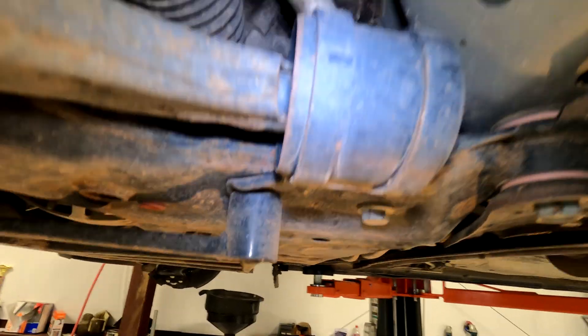Use a drill with a sandpaper roll to clean out the hole that the ball joint goes in, because mine has got all kinds of nasty rusty garbage in it. Use a drill or any kind of wire wheel to clean up the rust from the bolt. You don't want the rust to transfer to the new ball joint, so clean up the stuff as good as you can to get ready to put it back together.